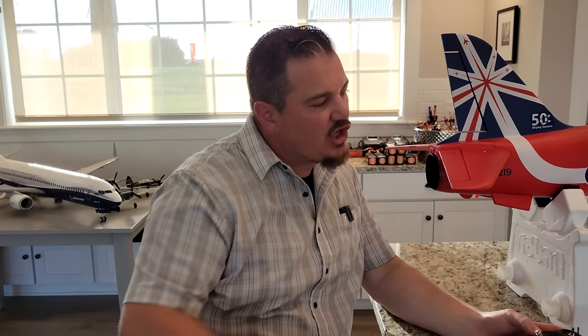But because I have such an aggressive amount of flaps here, and I want them for landing, because I want to bring that thing in like this, because that's the way we have to, given the tree wrap nature of our flight environment here. If you're coming in at a steep approach, you need more flaps, or you need thrust reverse when you touch down, or you're going to roll out.